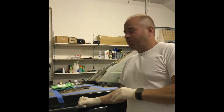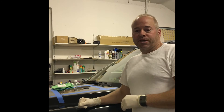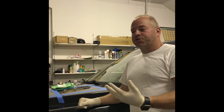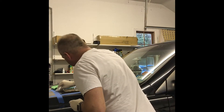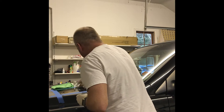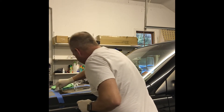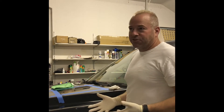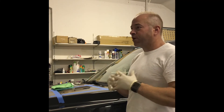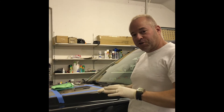I've got my supplies laid out. I'm going to apply a thin coat of the ceramic coating to the surface of the car, then wait about one to two minutes. It's actually pretty humid here today, so the silicone is going to start reacting with moisture and turning into that final glass coating. I'll accelerate the process using a heat gun. I'm going to use the crosshatch method — once up and down, then across. Now I'll let this start to cure for one to two minutes, giving the solvent a chance to evaporate and the silane chemistry, which is incredibly reactive with moisture, to start cross-linking. I want to give it one final smoothing once the solvent evaporates but before it cures too much, to give it a nice shine.